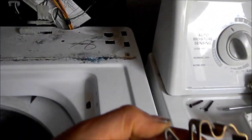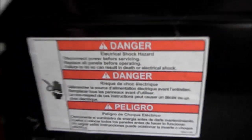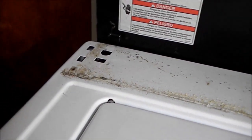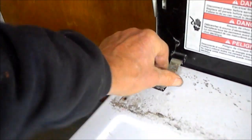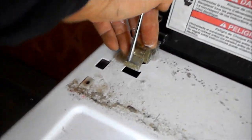The front console is basically held on by these clips here. There are two Phillips screws in the front that hold the front console in place. Once you've taken these clips off — I'll just clip in there like that — when you take them off, you just put the screwdriver in here and pry it back like that.